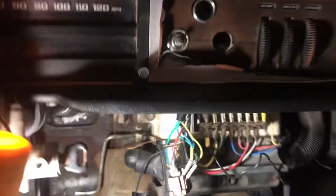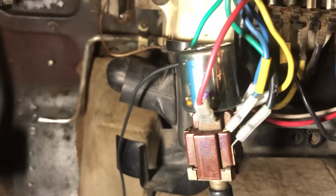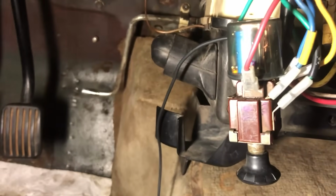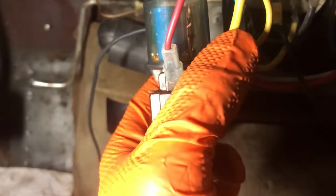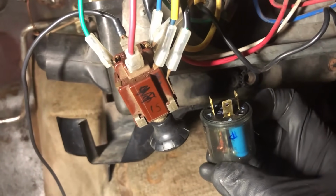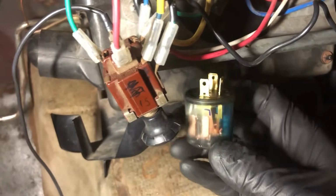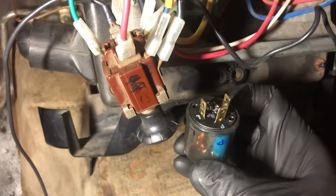Okay. The hazard switch has like too many wires that go to it. There's a couple of hints that Volvo wants to give you, but the book can be a little confusing. Like when the wiring diagram says blue and yellow, you're like, there's no blue wire with a yellow stripe. It's a yellow tag on it. This tag is very faded, but it says 15, the same way that this green tag says 30. Once I looked this up, it just made all the difference in the world. X is battery, P is pilot light, it's the dash light. L is load, and that's essentially where the switch is communicating to it. I just jumped up with joy once I got this all figured out.